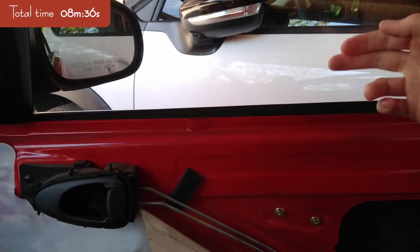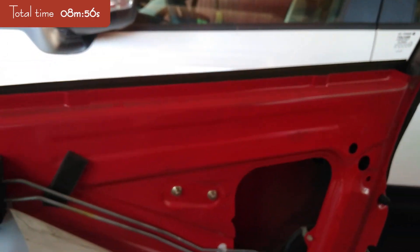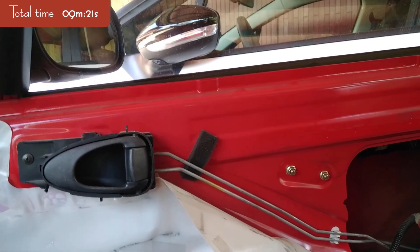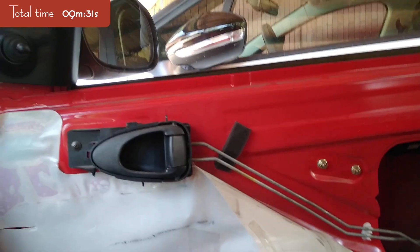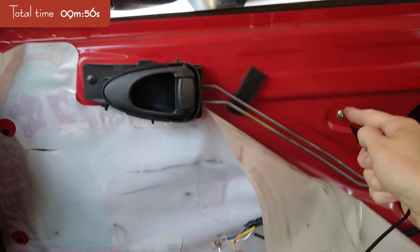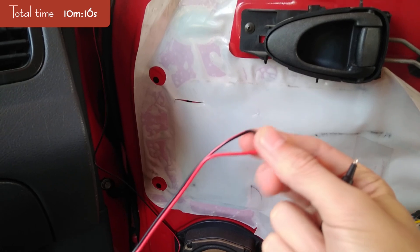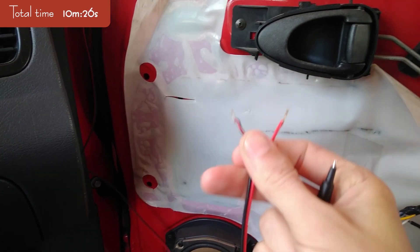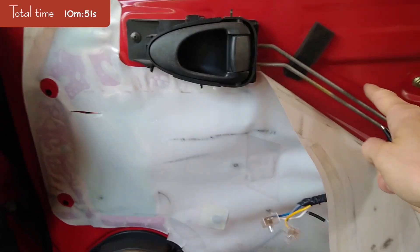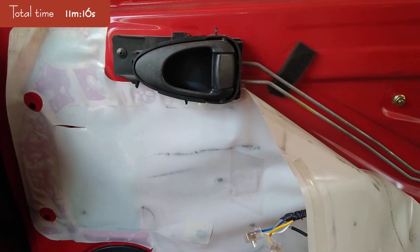But the installation that carries the window up and down. What I'll do is put one lead to the screw and the other one to the wire. If we hear a beeping sound, it means it's all good — and we will hear it. But when I touch the paint, we won't hear anything. So that is the issue.